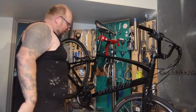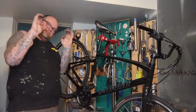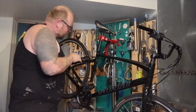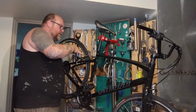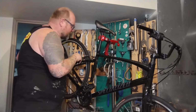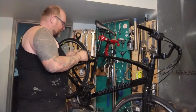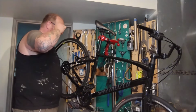It's a V brake. It's like a V and cantilever. They both swing in, and as they come in, they come down. So I like to have the pad pretty much as high as possible on the rim without it being up on the little line of paint that's not worn off yet, up over the lip. You can touch the tire. Just like a little millimeter showing. Low, low, low. I mean high, high, high.